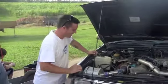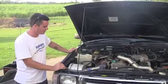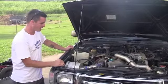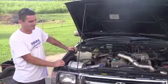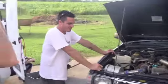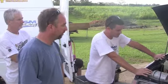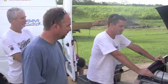We have a 2.7 litre twin cam 16 valve gasoline engine from Toyota, normally aspirated. When we got it, it didn't have enough punch for my dad and we wanted some more grunt. We decided the easiest thing was to keep it a high compression engine and turbocharge it — relatively high compression, with a small turbo and run relatively low boost on it.